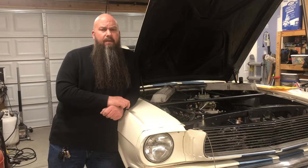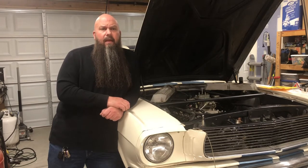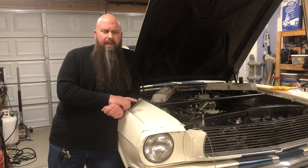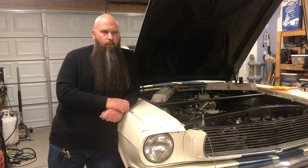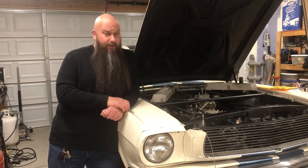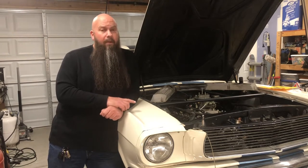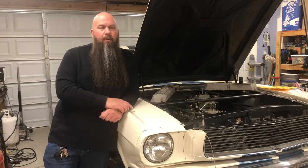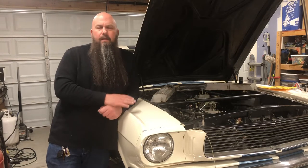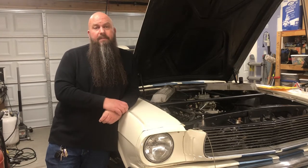What are the features that make a water pump a good water pump? We will get into that in detail, and then we need to talk about how that water pump is attached. Sure, we use bolts — but what condition are your bolts in? If your bolts are pitted or rusty, do you trust those bolts? We're going to talk about replacing the bolts and keeping track of what bolts go where so that you don't break a timing cover or end up with broken bolts because you over-torque them. So let's get started talking about the water pumps themselves.